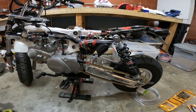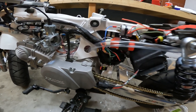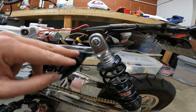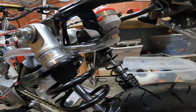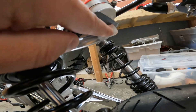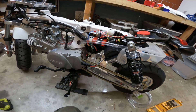This is the completed part without the bodywork on it — the bodywork does fit so I don't need to cut any fenders or side plates. As you can see it's pretty simple. I've got the tube going in with a hose clamp. One concern is there's a little bit of a dip here, so if oil makes it up this far it might accumulate — but I'll see how it plays out after a few runs. I drilled the hole in the back for the 90-degree fitting, got the cap on and the filter.